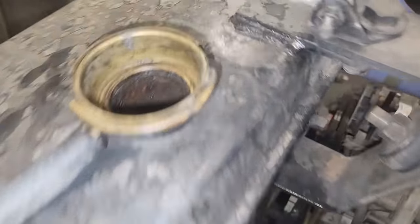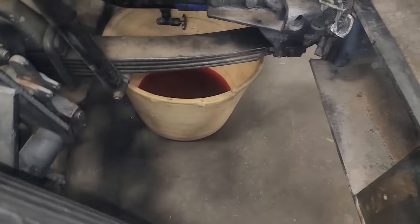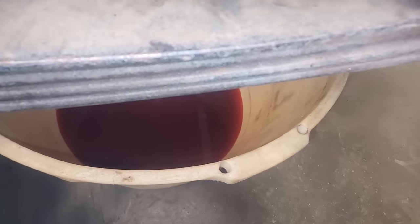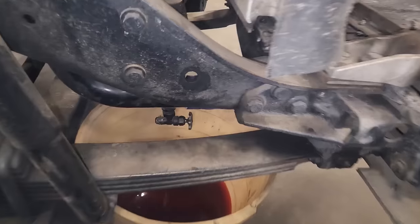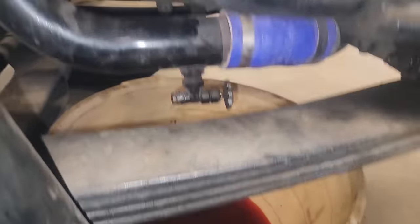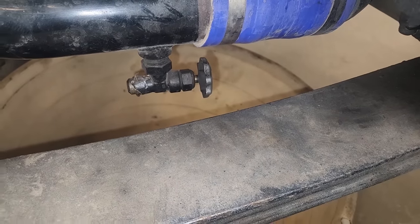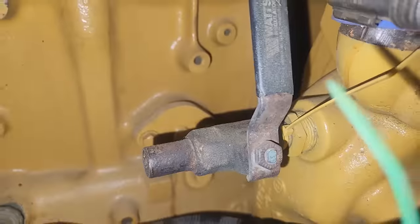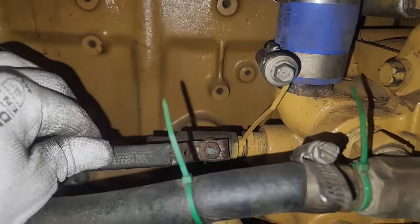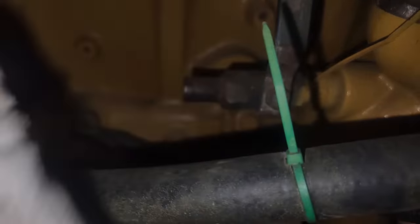The reason I did start recording is this: the overflow tank still has coolant — it's about half full — but I had already drained the coolant out. If you're familiar with how much coolant's in these systems, usually it's about 12 to 15 gallons. That only looks like maybe 3 gallons. This truck also has a brake saver, which has a larger oil cooler and holds even more coolant than most 3406Bs. So very unusual. And this should be pouring coolant out if the block is full, because that outlet is on the backside of the water pump — but as you can see, nothing there. That's where I was reading the pressure, where that CompuCheck fitting is.